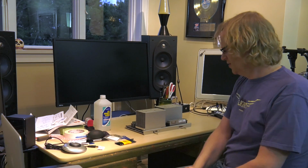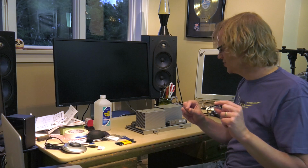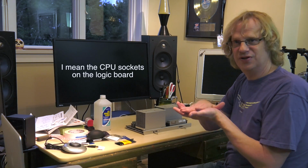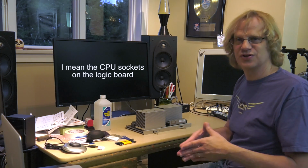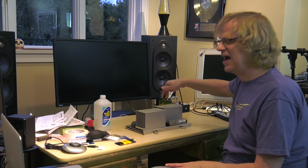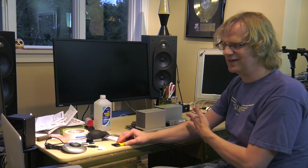So, fingers crossed again, because as we know, anything can happen. And I'm not using washers. A lot of people use 2 millimeter washers below the heat sink on the post so that you can't squash the CPU. But when I read about doing this the very first time, he said it doesn't matter. You can still squash the CPU, even if you use washers. So I'm going to do what I did in my last video, which is going to be more helpful this time around: count how many turns it takes to unscrew all the screws. Now that the processors are identical in height, that will come in handy. Whether it really did the first time I did it, I don't know.